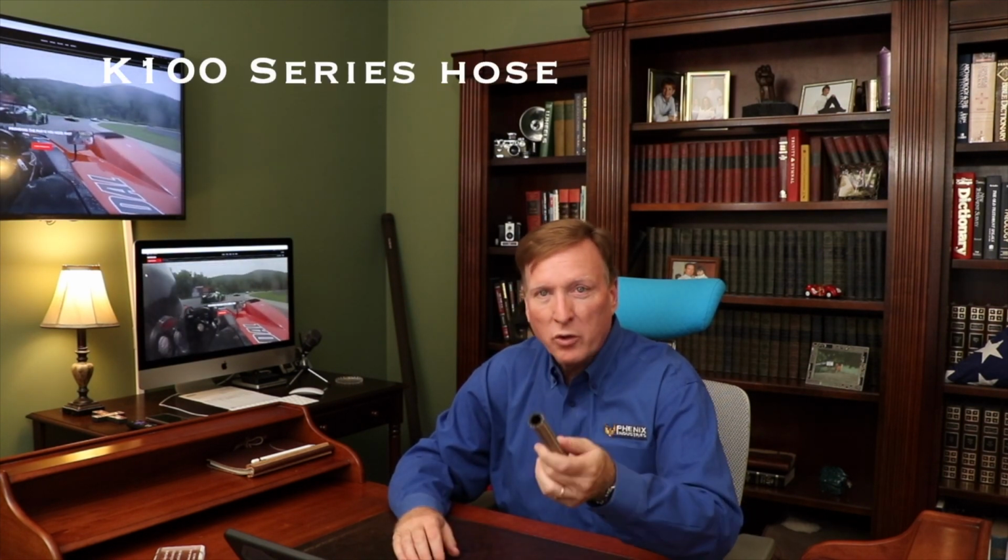This is our 100 series hose. It goes from 104, which is -4, up to 120, which is our -20. Again, keep this in mind: we sell -20 by the foot. That's expensive stuff, and you don't have to buy a 20-foot roll in order to get -20 hose. We will send you 3 feet if that's what your project requires.